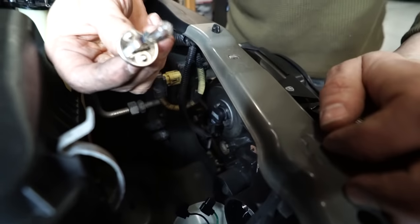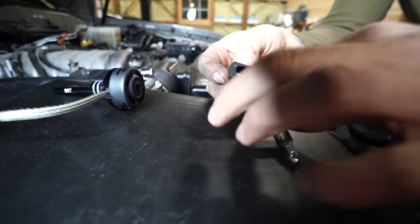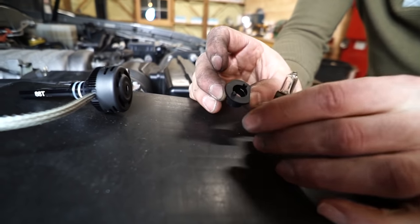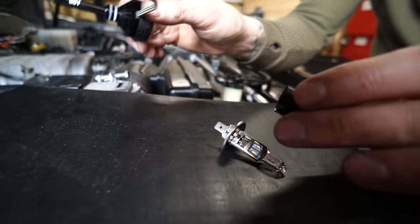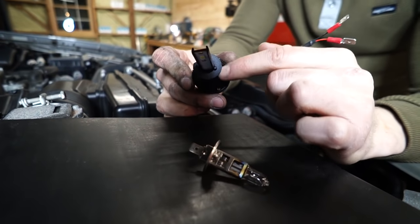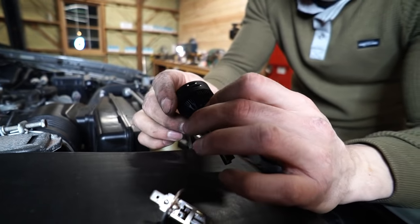All right, here's our old bulb here. So to install, you insert this in the same position here. They both got the nipples to line it up. And then you would just lock the spring down. And once this is locked in place, you can literally insert this and push it in here. But doing it this way, you could see how this bottoms out right here. We don't have enough room, and this sticks out too far to put our dust cover back on.